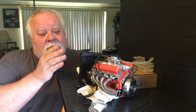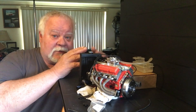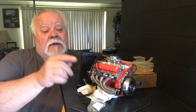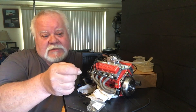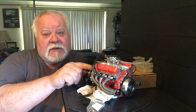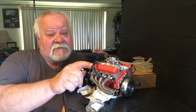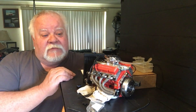When you get it, the engine comes with the CDI unit — it fits your distributor. You have to know some things about engines if you put this together. The other engines they make are pretty straightforward, but this one here you have to know things. Like the rocker arm — I had some shim stock I got from Tech Toys Net. Your number one cylinder is here, and because it's just like a small block Chevy — firing order is 1-8-4-3-6-5-7-2, crossing as it fires. It's just like a real V8.